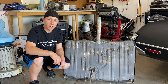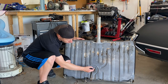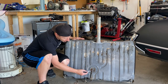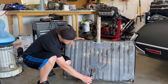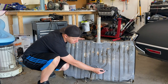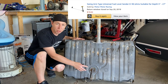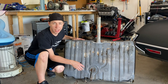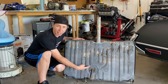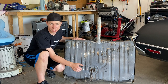For my install, I ended up wallowing out the hole quite a bit larger where the base of the fuel pump would fit into it. I then ran the lines out towards the front of the car. For the sending unit, I drilled out a new hole and bought a separate sending unit that fits down in there. So now I have the fuel pump installed here and the sending unit there, with the fuel line going out and the return line coming back. I've had zero issues with the install since doing that.